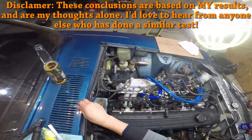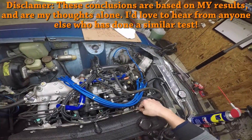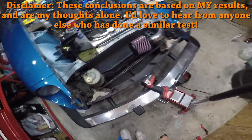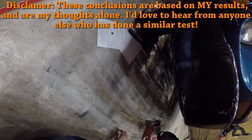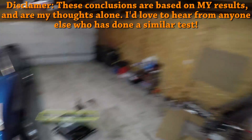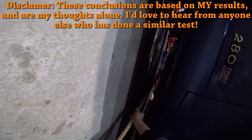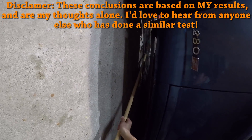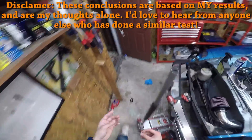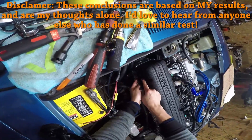Now, if you plan on driving the Datsun really hard or taking it out to a race, that's a different story. Then you should listen to the camshaft manufacturer and purchase block-off plates to get rid of the spray bar so you can direct all the oil only to the camshaft. Or you can purchase a high-volume or high-performance oil pump so that both systems are actually functioning as designed. I would imagine that having both an internally oiled cam and a properly functioning oil spray bar is probably the best method of lubrication in extreme conditions.